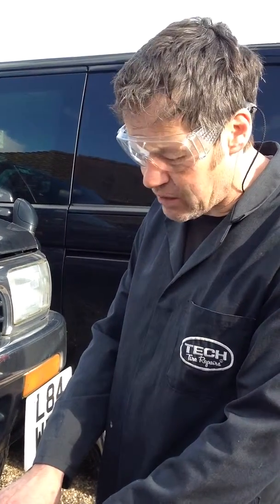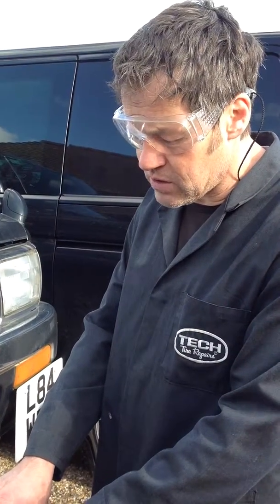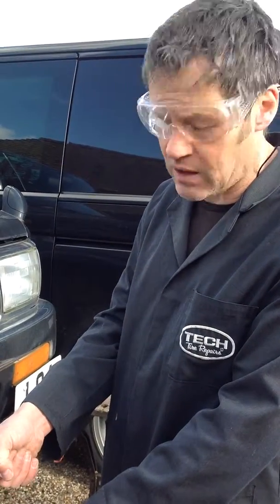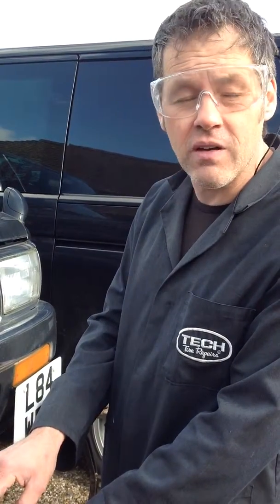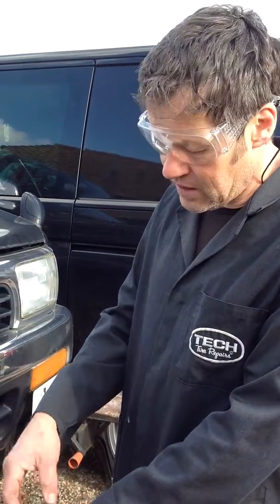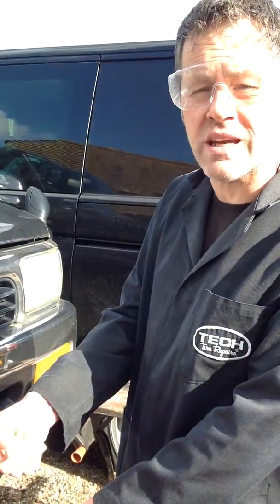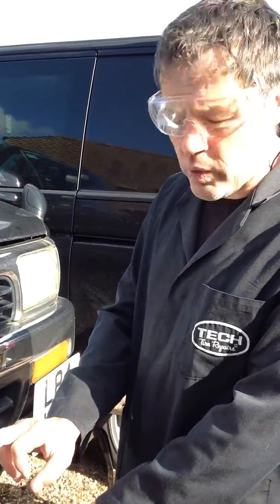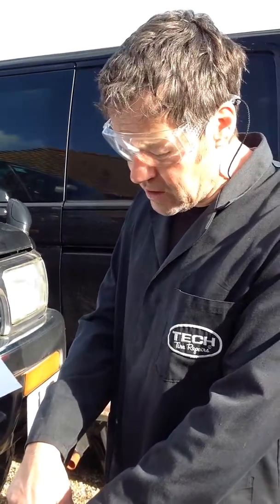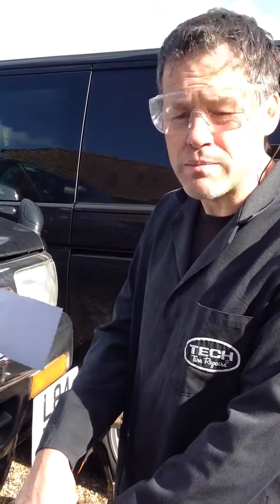The only thing I probably missed out is the tyre pressure. You want the tyre really at around 1 bar, which is just over 10 psi when you insert that string. If you have it any greater, you'll find that it's difficult to push it in. If the tyre's dead flat, then the tyre will pinch up on the needle and you'll find it hard to insert it. So that's a tip. When you're inserting the string, you really need a tyre about 10 psi or 1 bar.